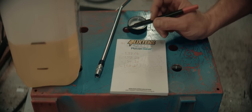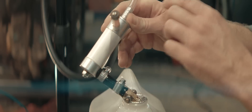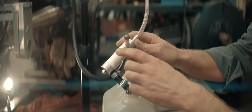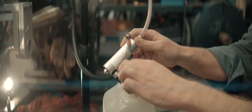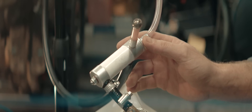We're hovering around 1 minute 37 seconds — I'll use that as the baseline. The one reading which was 10 seconds more was when I didn't open the valve and prime this reservoir before I opened this valve. This little surge tank makes a difference with this long a fuel hose in a gravity-fed setup. Let's get that pump and regulator going and see if we can match these numbers.